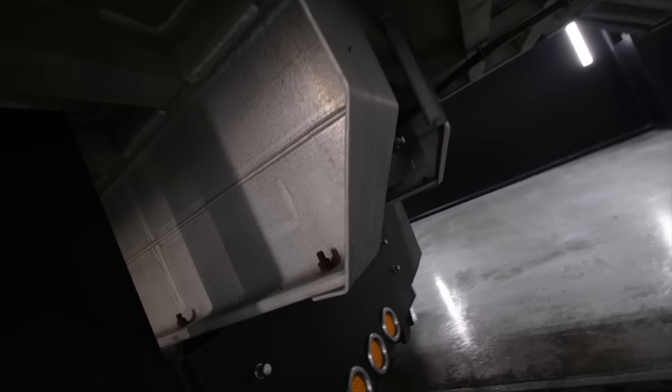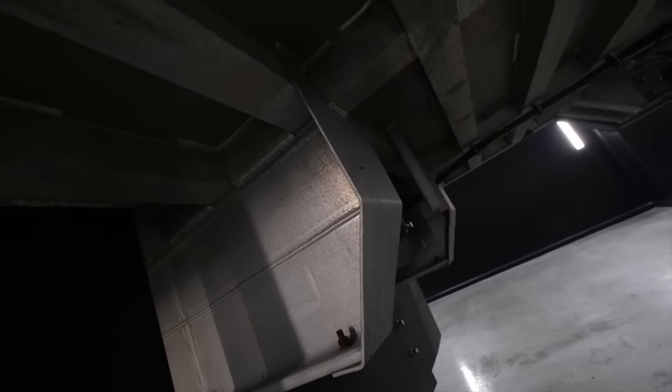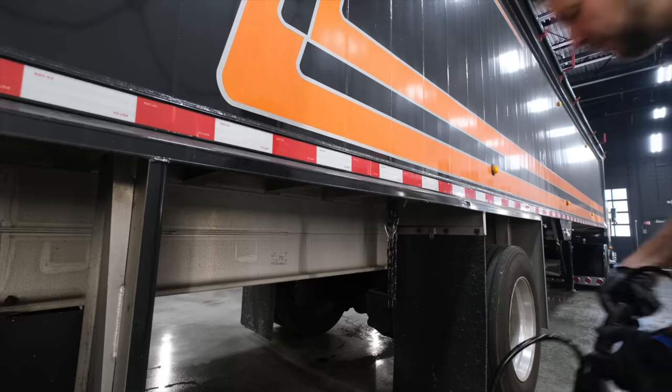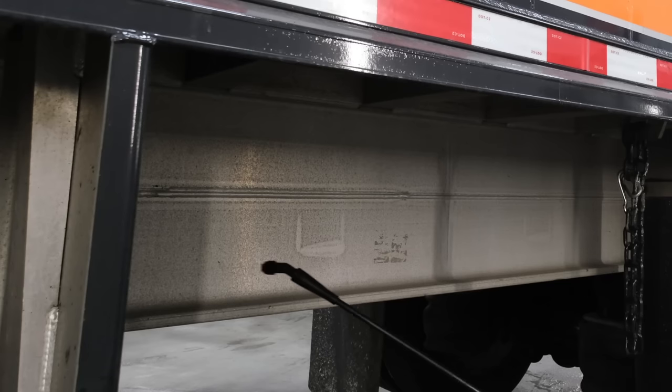And in some instances like this, that's where you might say 50-50 would do more to help. Will it get it back to reflective? I don't know. We'll find out. I doubt that it will, though. At a certain point, the aluminum becomes rough, and that diffuses light, so it doesn't show that reflection anymore. That's where the limitation is, you know. At a certain point you have to physically smooth the surface out with a cutting wheel. Let's see what this 4-to-1 mix of M-Shine will do right here. This is real rough aluminum.